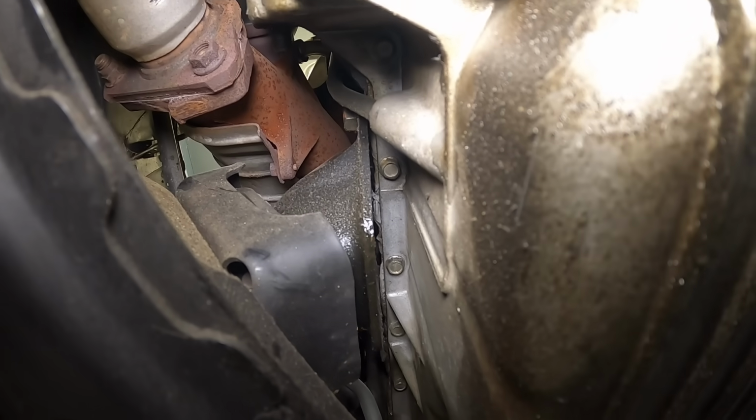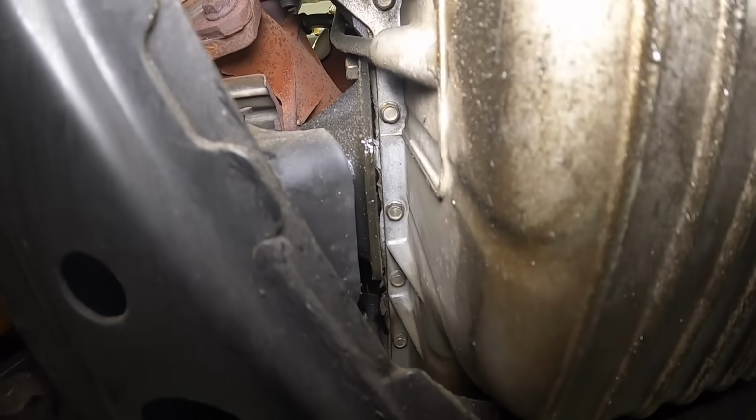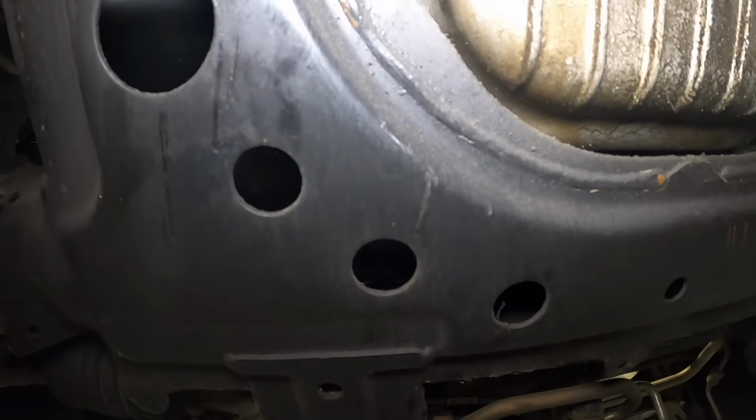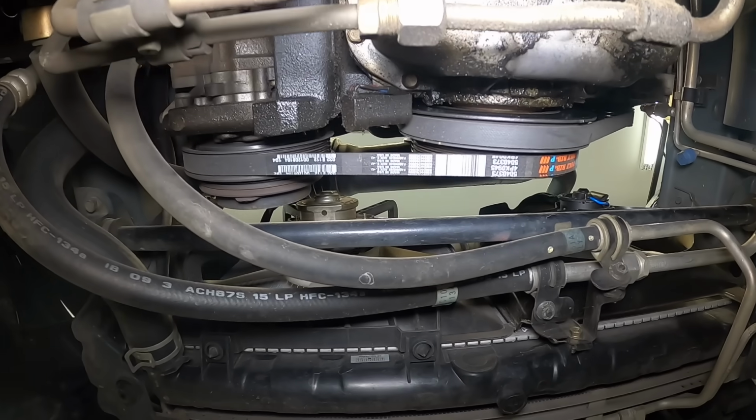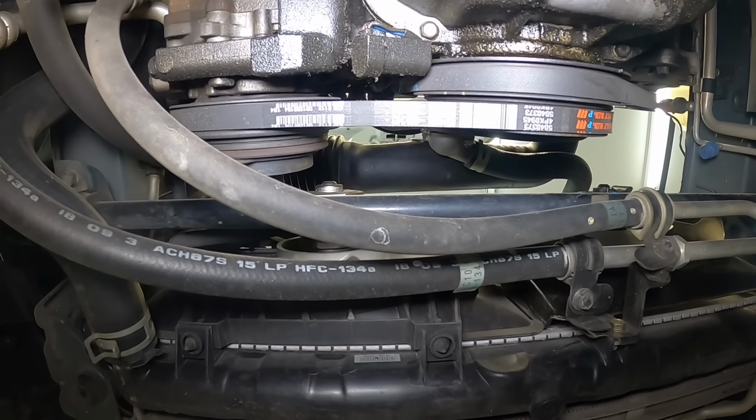Once we have our oil leaks fixed, it's time to clean up any oil left behind. We need to be really careful here. We don't want to end up contaminating other parts of the engine while we're doing our cleanup. Whether you're using a brake parts cleaner or an engine degreaser, you just want to be careful where you're spraying it. Just like when we were looking for oil leaks, I like to throw some cardboard underneath the car to catch any of that sludge that's going to drip down our engine.